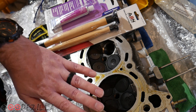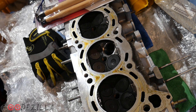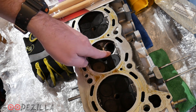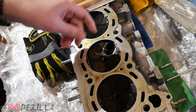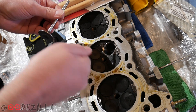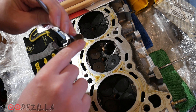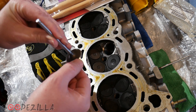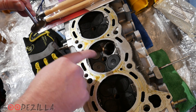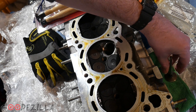So first I want to just clean the area off — I'll use some brake cleaner and a microfiber towel. And then if I can find my permanent marker, we're just going to mark up the seat here and also along the edge of the valve so that when we are lapping it and we take it off, we'll see that the marker will be gone and we'll have just metal showing, so we know those areas are actually seating together. If there's any marks left from the marker, we need to keep going so that we have an even surface.